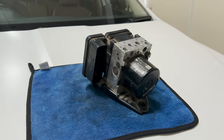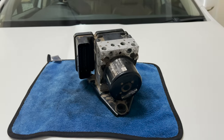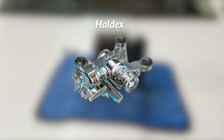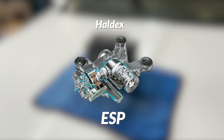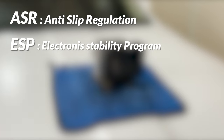In this episode we are going to focus on the ABS. I needed to upgrade the ABS on the car as it only supported ASR and not ESP. But for proper functioning of Haldex, which is the control unit for power transmission to the rear wheels, ESP was needed. ASR stands for anti-slip regulation and ESP stands for electronic stability program or protocol.